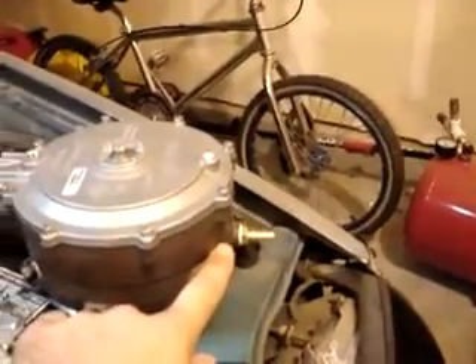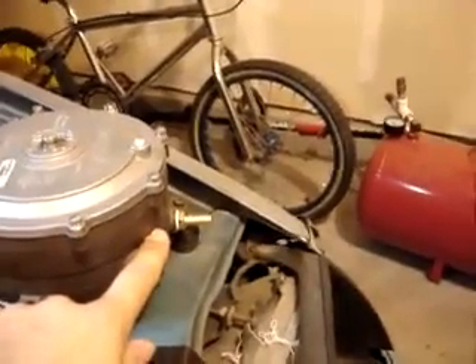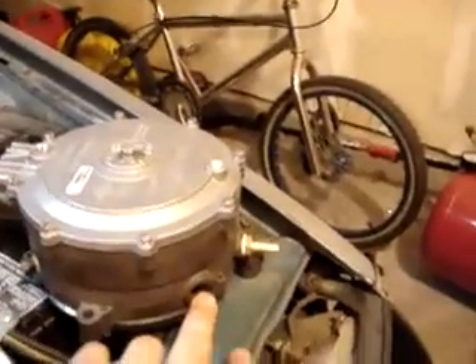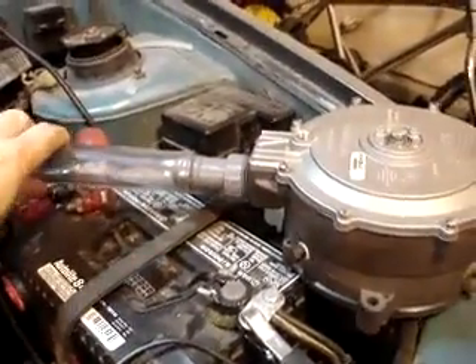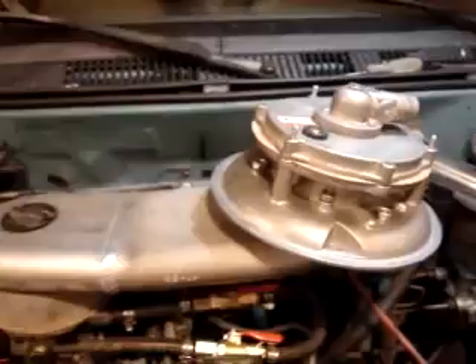Yes, you can pressurize HHO with no problem — I've had it up to 60 and almost 80 psi. It can be dangerous if your container gets hot in the sun or there's a spark; yes, it would explode, just like gasoline or hydrogen — it's just like any other gas. So you can pressurize it. This regulator can have as low as 3 psi on the input end and about 5 inches of water vacuum on the other side. The more vacuum here, the more it lets through, so it won't waste any HHO like it does when you just flat-inject it into a regular intake.